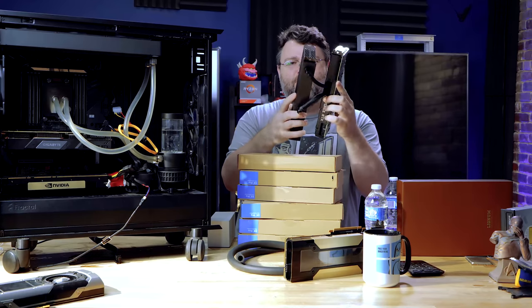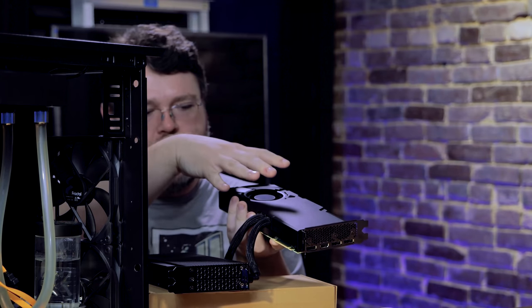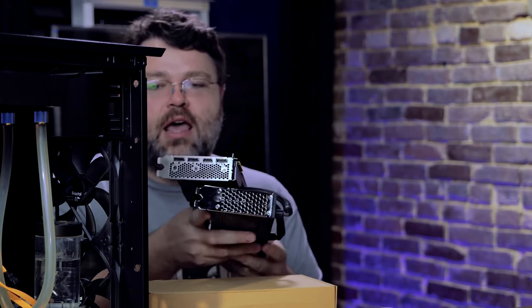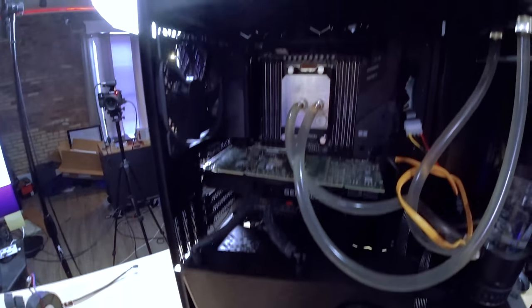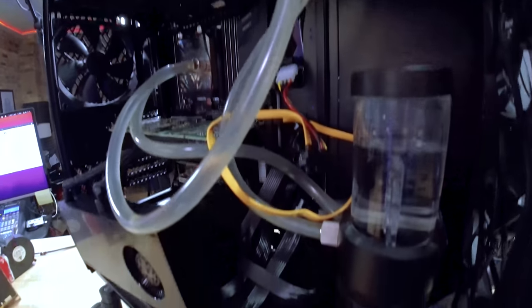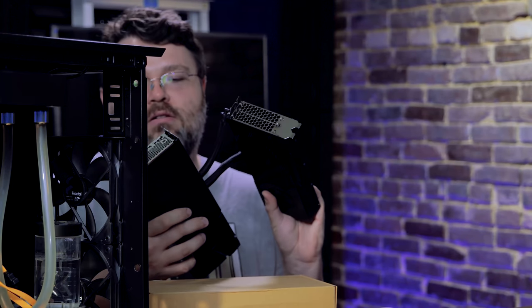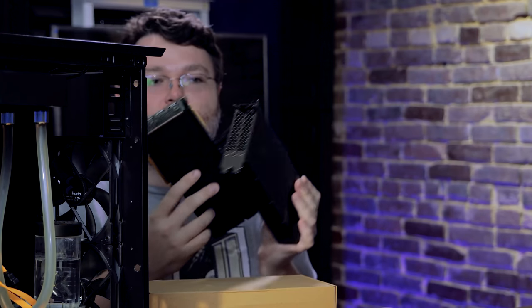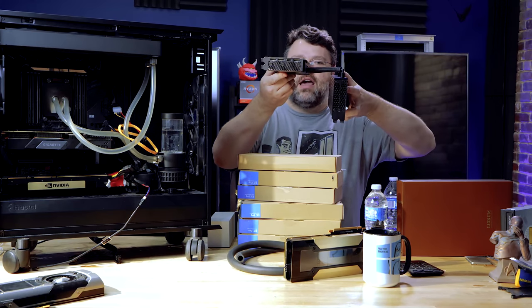EK sent over the mother lode. There's also one honorable mention: Ace Attack. This is an RTX 2080 Ti but it's only a two-slot card. That's great when you've got a case like this because Threadripper only has four expansion slots, and I can put this card sideways in the vertical slots without taking up extra room. I can use all four x16 slots without resorting to the expense and complexity of a custom loop. It'll clock a little higher and be cooled a little better because it's not one but two blower motors. I'll do a separate video on this.